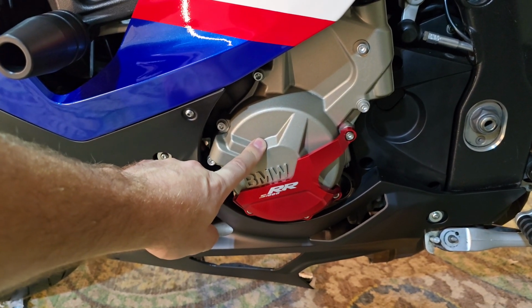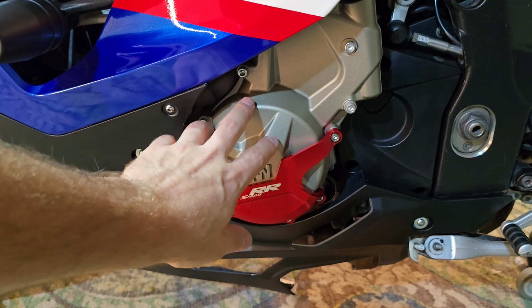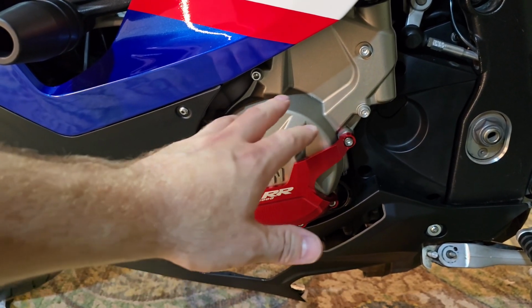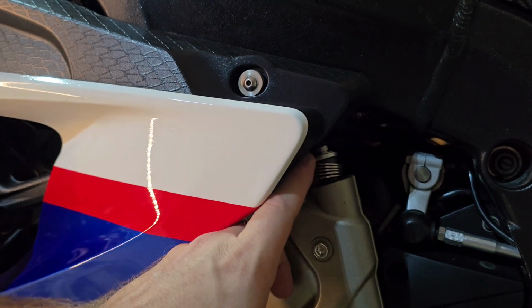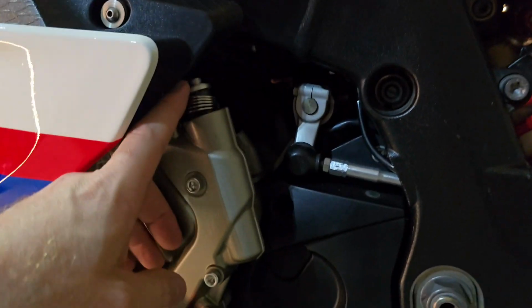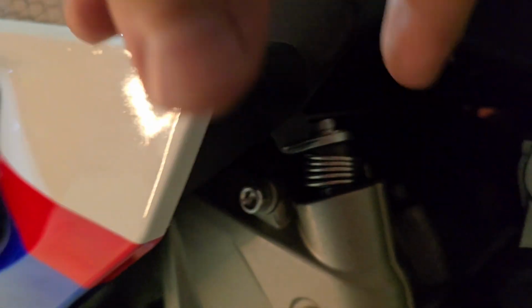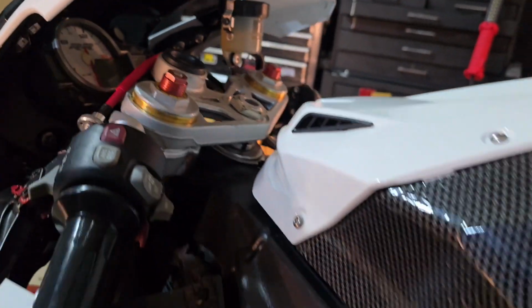One of the biggest issues with this bike was this right here. Okay, this magneto cover, stator cover, was cracked. I was worried there might be some bent shafts or anything like that in there. It turns out there wasn't, thankfully. But this was a pain in the butt to get on and get matched with the clutch lever cable. So I had to get a new clutch lever cable, and it just took a long time to finally get that situated, where it was actually pulling and letting me shift through with a good pull on it. So brand new lever, brand new cable there.